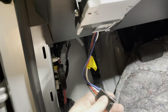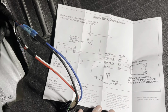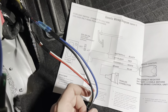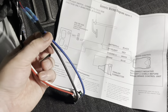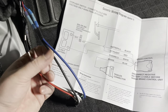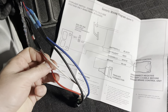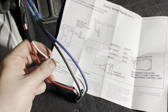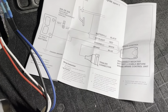This is the wiring diagram that came with the brake controller, and the wiring colors shown here are the same as the universal adapter harness. Triple-checking everything: the brake line going out to the trailer plug is blue, and that matches up with the blue on the body side of the vehicle. Black is our battery supply from the vehicle, which on the factory wiring diagram is red and blue — that matches up. Red is our stoplight signal coming from the BCM, and that matches up to our white and blue. Finally, white is our ground, and that connects to the black wire on the wiring harness. All the wiring looks good, so I'm going to plug it in, reconnect the battery, and make sure everything's working great.